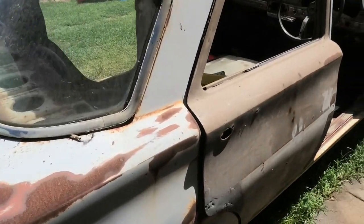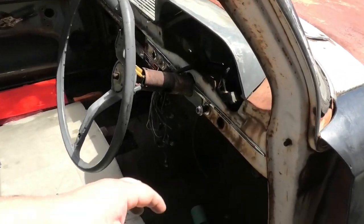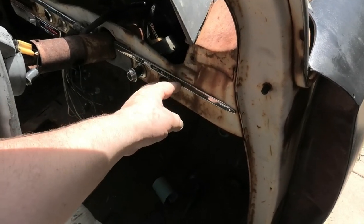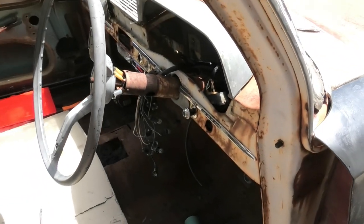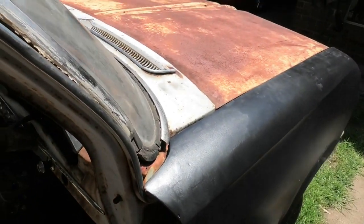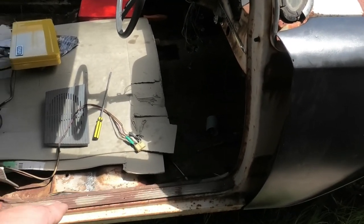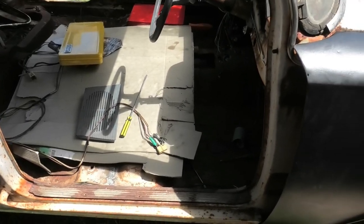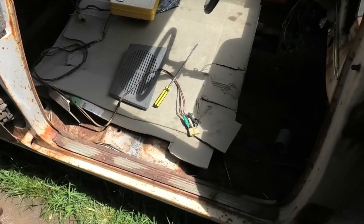On the trim: for EH and EJ ignition switches, EJs have lock and start only, whereas EH actually has an accessory function so you can turn the key back that way — a little unknown fact. Also, the scuff plates rust out quite easily because they're just bare steel, possibly galvanized once upon a time but that was a long time ago.